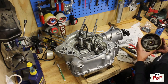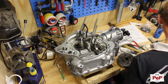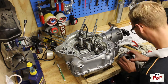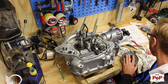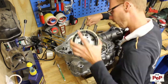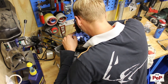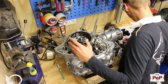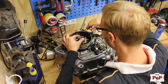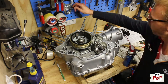Since I have some spare engines I could choose the best rotor. The rotor has a sprocket that is directly connected to the starting mechanism, so it's important to use the best of the two. The camshaft chain sprocket actually consists of two sprockets with springs inside. You need to open it up using for instance a screwdriver. Once you have the two open you can connect it to the other sprocket of the rotor. With a flashlight you can check if everything is timed correctly. I decided to wait with tightening the head nut to torque specifications until the engine is really sturdy so I can do it properly in one go.